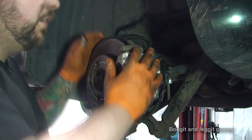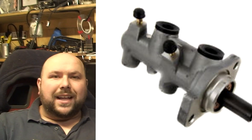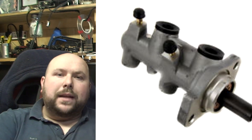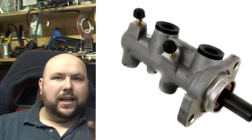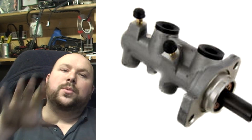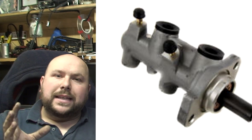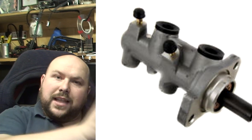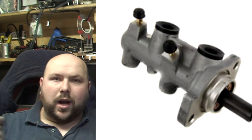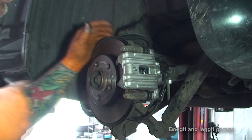One thing I did forget to say — there are two copper washers on these banjo bolts. Make sure the copper washers are there, because otherwise it will leak. Make sure it goes in and don't cross thread it. All we've got to do now is actually bleed these. One thing I did forget to mention on this Audi: because we completely let all the fluid drain out, there are actually two bleed nipples on the cylinder as well. I'll put a picture up so you can see. You need to undo those as well, otherwise you'll have no pedal. Once you pour the fluid in, I bleed the calipers first, then bleed the actual cylinder, then double bleed the caliper again and go back to the cylinder — I do it twice that way to make sure.